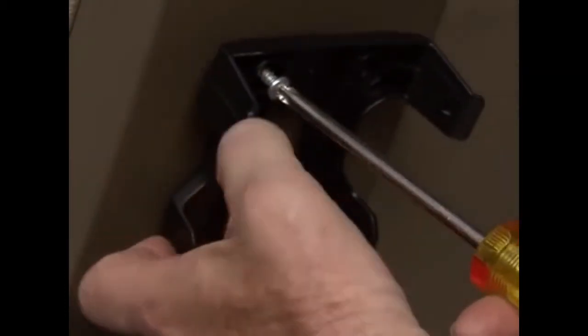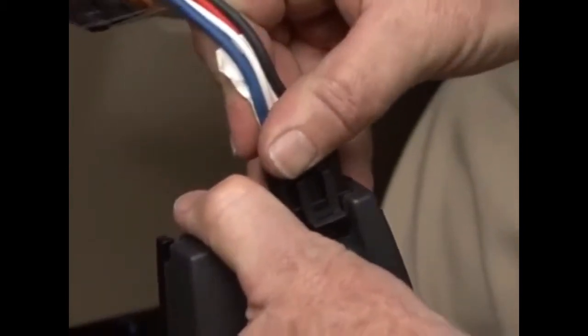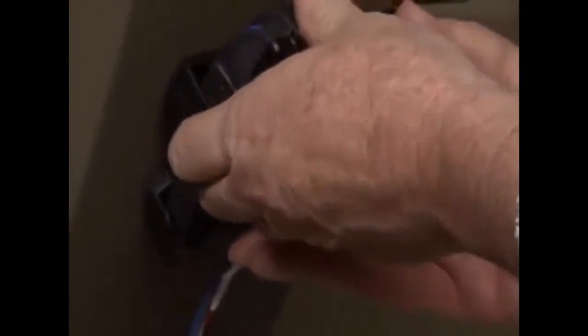The back of the control must be positioned toward the front of the vehicle, or in the direction of travel. Locate the mounting position on the face of the dash in the most convenient position possible and within easy reach. Many brake controls have a primary operating range — nose up or nose down. Refer to your installation instructions for the range that applies to your control.